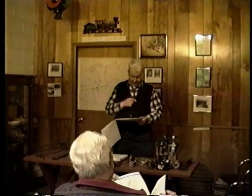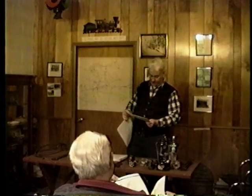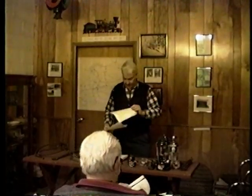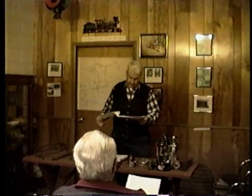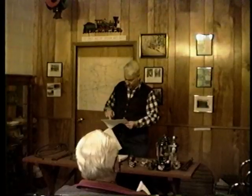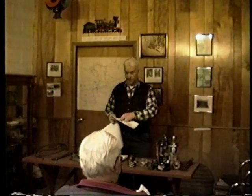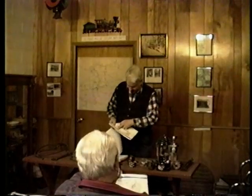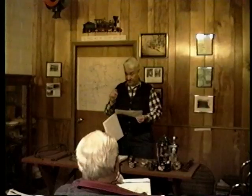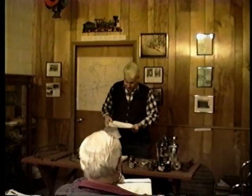It was shaped very similarly to the boiler. It was very short, but it had tubes in it, vertical tubes that were copper tubes. And I haven't quite figured out whether they were swaged or welded or what, but the picture on the right shows the top of the boiler, and there's a cutout there that shows the top of the burner. And the tubes are the bigger circles, and then there are these little dots around the circles. And they were drilled through the top plate of the burner, and that's where the vaporized fuel came up through.